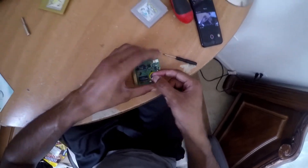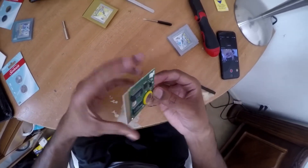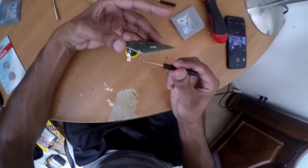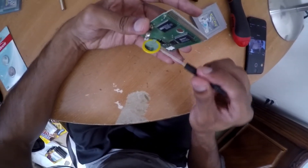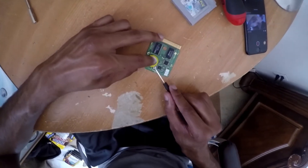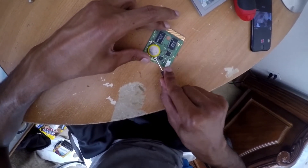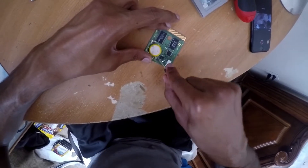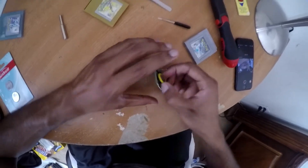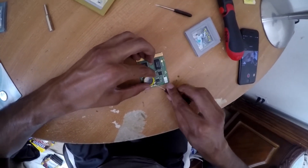So that top arm is now off. I'm going to pull it back — be careful not to break it. Then you can pull this one out and see the bottom of it. There's another arm and it's spot welded on, so now I'm going to work towards taking that one off. I'm going to try coming up under on this side, pressing downwards to see if I can get it leveraged. The cool trick is that once you get one of them off, the battery is really only held on by just one spot, so you can kind of twist the battery and it'll come off.